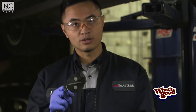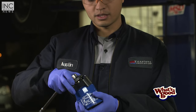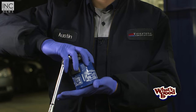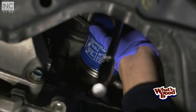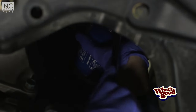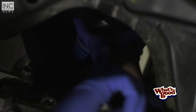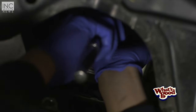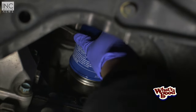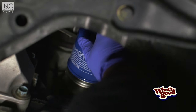Next step is to get your oil filter wrench and attach it to your ratchet. When you're loosening it, get around it and then loosen it — lefty-loosey, righty-tighty. We're just going to loosen up the oil filter right now, not all the way. Just loosen it until we can loosen it with our hands. As you can see, I can loosen it a little bit now with my hands, so this is going to make things a little bit easier.